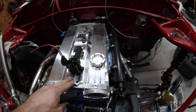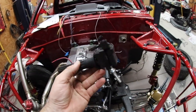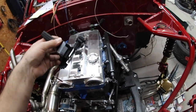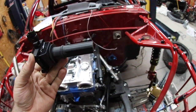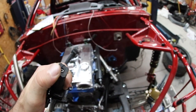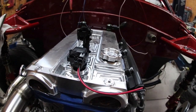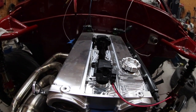OEM covers and a different plate are going to be different. This is a Frontline Fab valve cover and a Frontline Fab coil-on-plug plate. This is what it looks like when you get it in the box — it's got these little bolts on it, it doesn't have any wiring connectors, and then it's got its boot, and inside there is actually a spring. The finished version looks something like this: a Toyota two-wire connector — I will put the part number in the description — and this is the cut-down boot with a cut-down spring inside. This right here fits over the top of the plug; the boot I just cut with a razor blade.